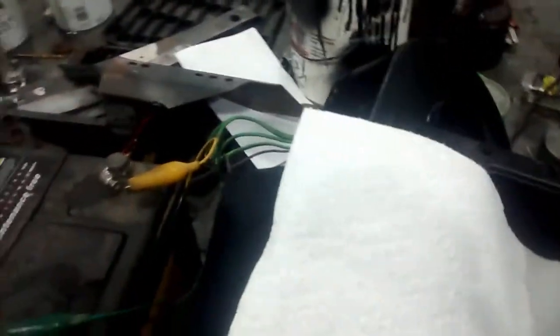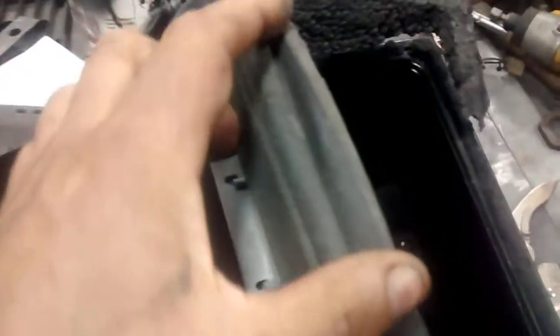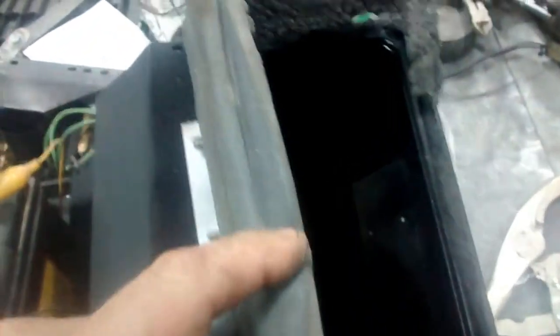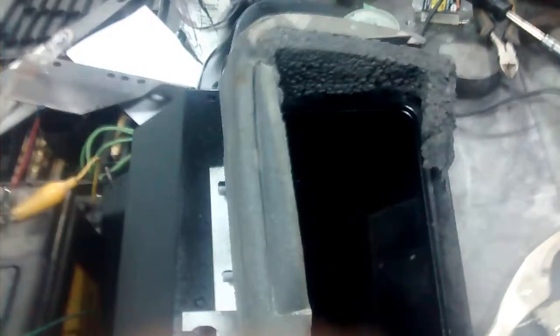Then you can see. And there isn't really a big problem with the heaters. The blower's great. It's just that it's forcing its way through a tiny little hole. And I meant to show you this the other day. Still got it. This is the area of the hole that goes through the bulkhead. A great big heater and you're pushing it through a little hole like that. So you get turbulence and you get all sorts of problems.